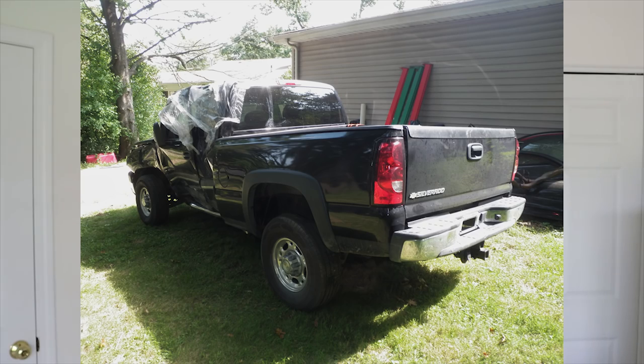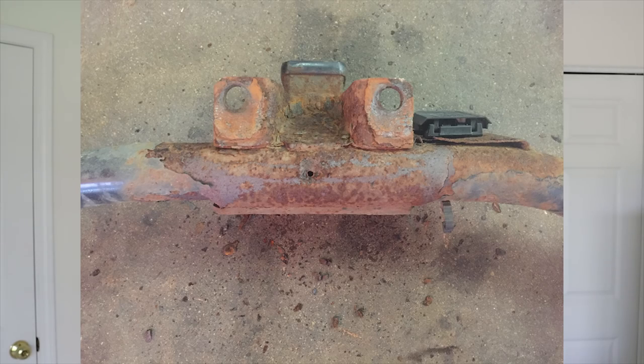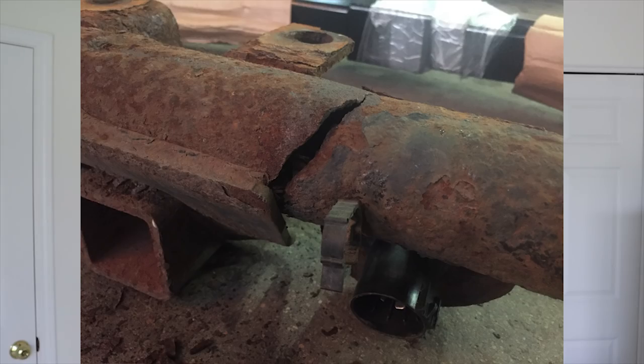I did say two pieces of equipment. My truck is a diesel and I am a fanatic about maintaining it, so it doesn't need a whole lot of work. I don't have a video of the original rebuild when I bought the truck because that was my pre-video days. But I recently did have the trailer hitch rot out on me - it's a pretty common problem on these trucks. The tubes for the trailer hitch get full of dirt and water and they rot out from the inside because it's always damp in there.